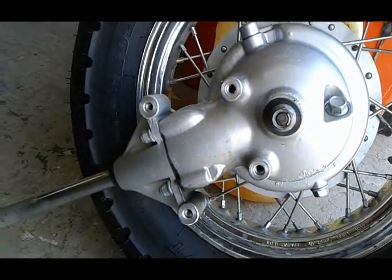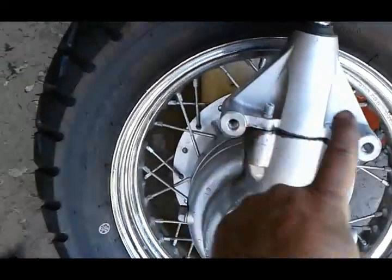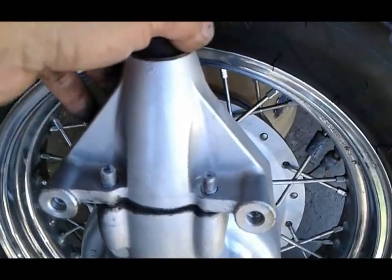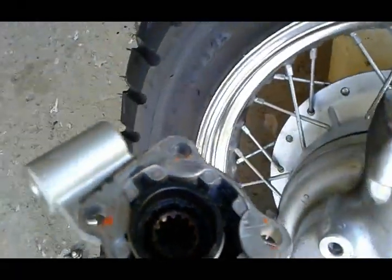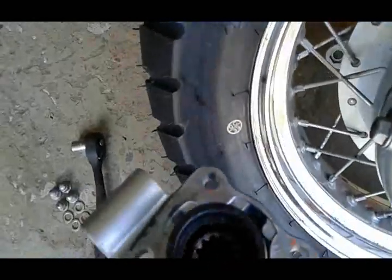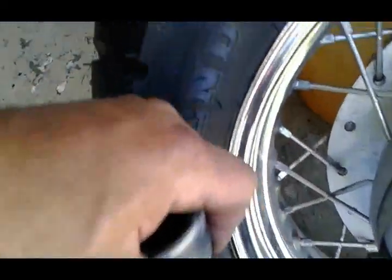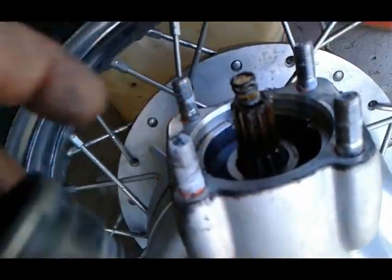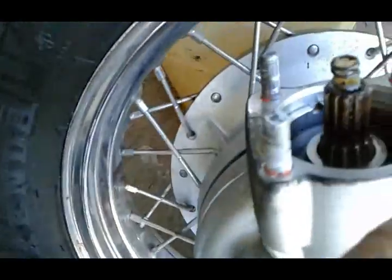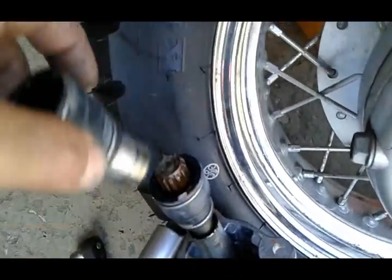If you have it done at a shop, be adamant that they lube that for you. I'm going to show you what it looks like. I've got the four nuts out — you pull this out and you're going to see the coupler here that I was talking about. You can actually pull the coupler off; there's a rubber boot over here. Here's the coupler — there's a spline in here, spline in there, spline in here, and spline in here. This one is not dry but it needs to be lubed up, it's due. So you want to lube all these splines — one, two, three, four.